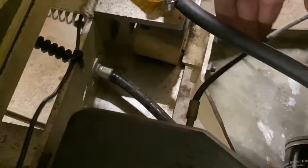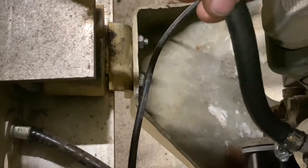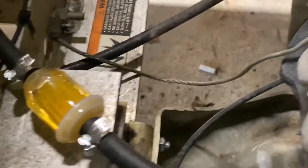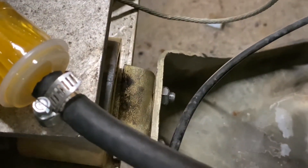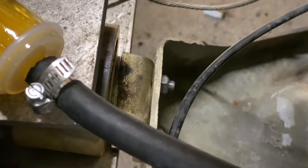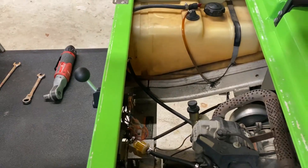Alright, I was able to get that bracket flipped over. It was kind of an easy switch, but there is no more contact. The bushing itself on the bottom is creating about a quarter inch gap. There's still a lot of weight sitting down on that bushing, and there's really nothing going on on the top of the snubber, and that concerns me a little bit. It's almost as if the snubber itself should be flipped over with the point facing down, because I think in a normal situation there was more upright pressure than down pressure — and now it's the opposite since the engine weight is literally hanging on this bushing at all times. So I'm going to look into that a little bit more. It was an easy fix, so if I do got to change it, I'll just go ahead and do that.